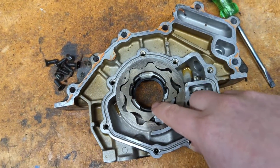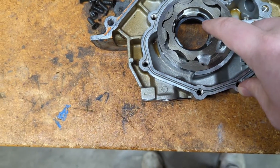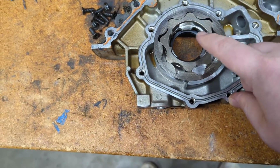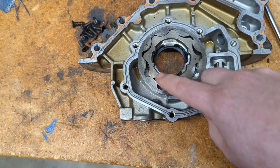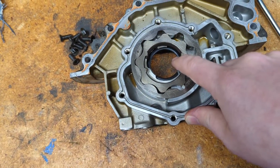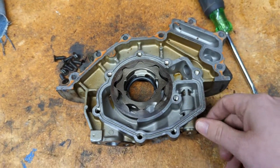If you're going at huge RPMs or like a very abusive rev limiter, you can abuse these oil pump gears and they can break. A typical one is probably cast and then machined down to this perfect shape, or maybe a powdered metal type thing. Whereas the better ones are probably one solid extruded piece of billet, or even a forged piece that's machined — just higher quality materials. That prevents these from breaking, because obviously if this ring breaks, it doesn't pump and the pump goes bad.